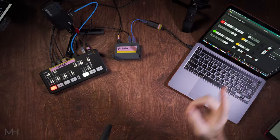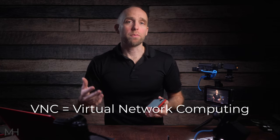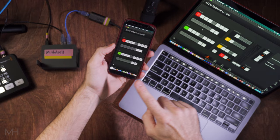I'm using the MacBook's built-in screen sharing functionality of macOS, and on my iPhone I use a VNC app — specifically VNC Viewer. VNC stands for Virtual Network Computing. A VNC app on one device can view the screen of another device as long as a VNC receiving service is running on that device. macOS screen sharing also allows VNC connections. It's essentially a remote desktop app that lets you interact with the remote screen — click around, even type. This is why I need the wireless router: my phone and the VNC app can only find and communicate with my laptop if they're on the same local network.